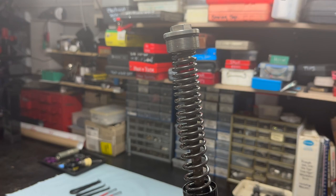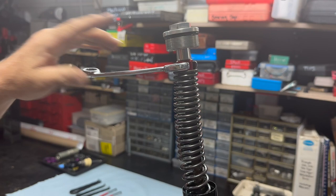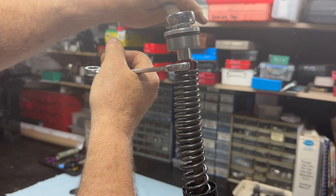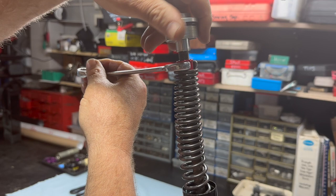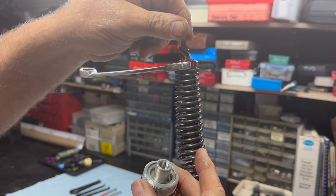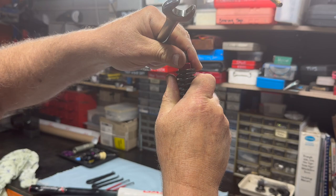As soon as you can wind it off you can pull... there should be a preload spacer there and there's not — all we can see is the spring, so obviously there's a problem. Use a 17mm spanner to get the cap off. Pull the spring down and lock it underneath the jam nut. 17mm on there, let the spring come back up — that holds it in place. Then you want a 22mm for the top. Hold that 17mm to stop it going in, and release that 22mm at the top. Careful winding it off because you have the compression adjuster underneath which is a little fragile — just wind it off and pull it off vertically. See the compression adjuster at the back there? Give that a little wind because it's in the middle of its movement and that whole rod you can carefully draw out. It's quite fragile so be careful. 17mm off, release the spring, and now you can take the spring out.